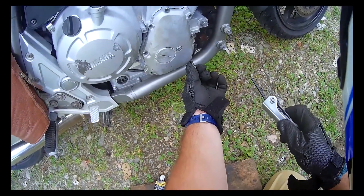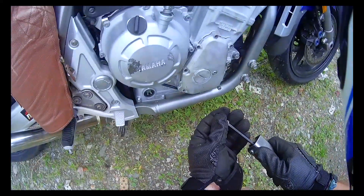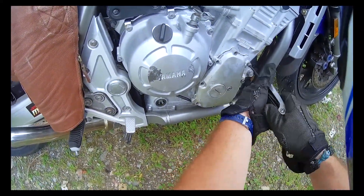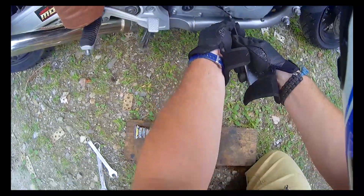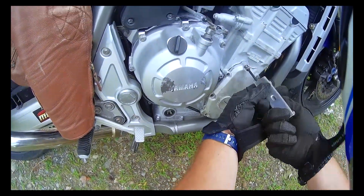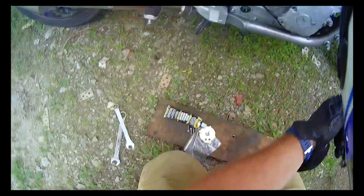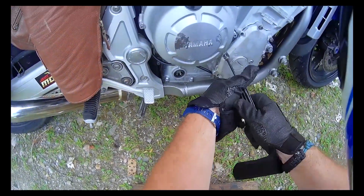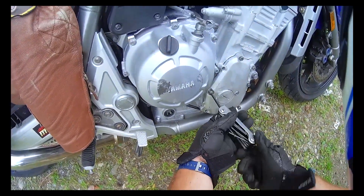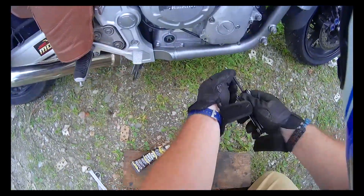Find the deep bolt and make sure it goes in the right hole. When torquing these down, I get them all nice and tight with a hand crank — don't go too crazy tightening these, they don't need to be too tight. I also need to put my spacer back in before I forget. If you get these too tight, they will cross-thread that nice soft aluminum case, and then you'll be in for a bad time.